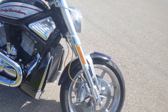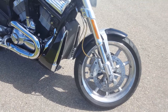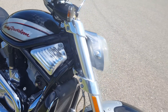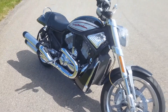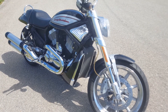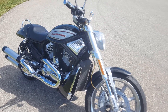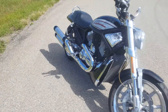This was also the first Harley to include Brembo brakes — they brand them as their own, but they're actually Brembo brakes. Dual brakes up front with steel braided lines from the factory. Excellent stopping power, not something you can say of a lot of Harleys. Good feel — not a lot of initial bite, but very progressive. Feels good to the hand and easy to modulate with as much power as you need for a machine like this.